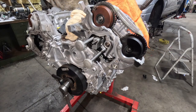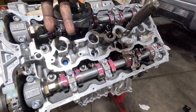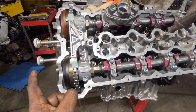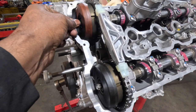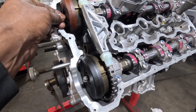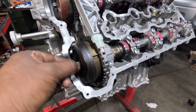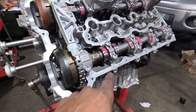Let's do a recap before we go any further. Camshafts were installed with the lobes aligned this way and this way. After installing the camshafts, we installed the adjusters loosely. We installed the new bolts with some ARP torque lubricant to allow smooth torquing and prevent galling the bolt surface. This has been installed with no gaps — I tightened it, then backed it off 90 degrees, so the adjuster is still moving independently of the camshaft.